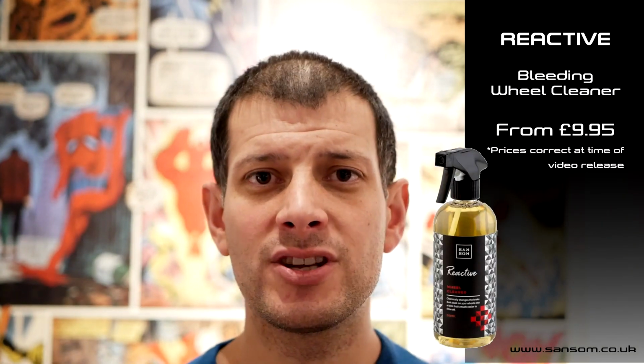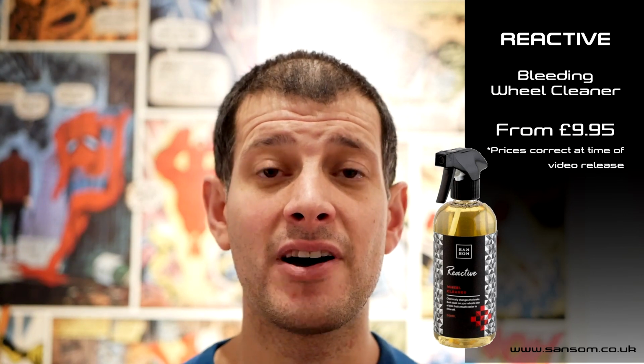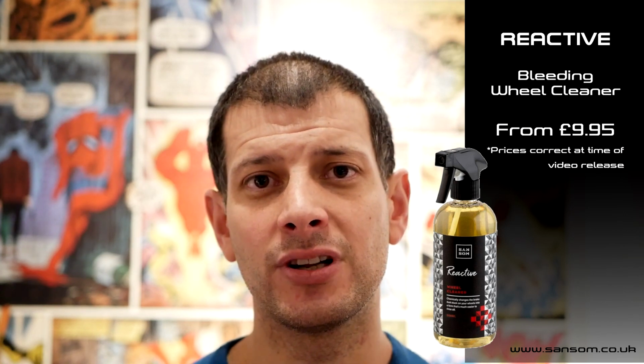The reactive wheel cleaner, as you saw in the Instagram worthy shots, does actually have a very quick and good colour change. It is strong, it is potent, it is very, very capable in what it does. It's a very thick viscosity, and in that it dwells on the panel for quite a long time. The downfall of that is that it doesn't have the best action as far as spraying over the whole car, and Michael did complain that it was causing his hands some discomfort doing the whole thing.